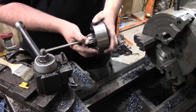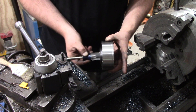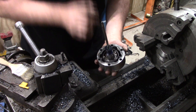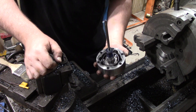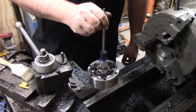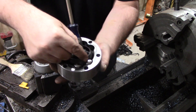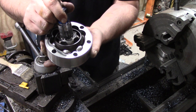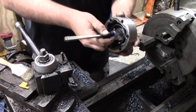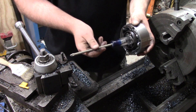What bugged me about these is that this is a plunging joint — you can see the inner race can go in and out. I always assumed since this looked just like the inner joint on the MR2 Turbo that it acted the same. But if you do that to the MR2 Turbo joint it falls apart. This one is designed so the balls actually contact the inner race before coming apart, and it does it on both ends. That's how they're running plunge joints on both ends with the axle shaft just floating in between.